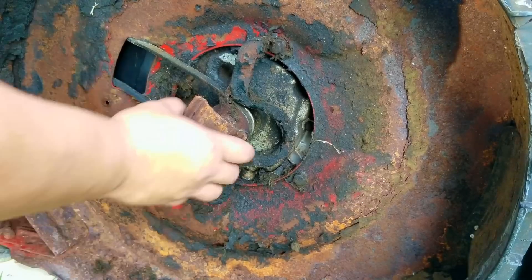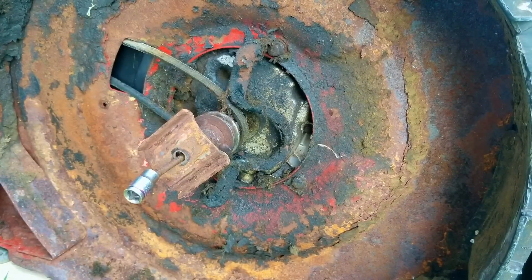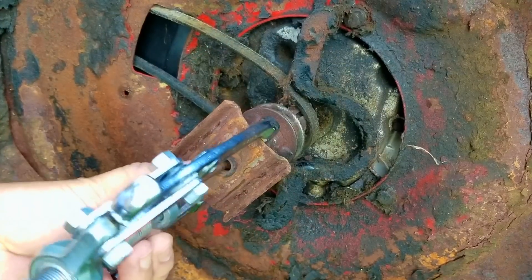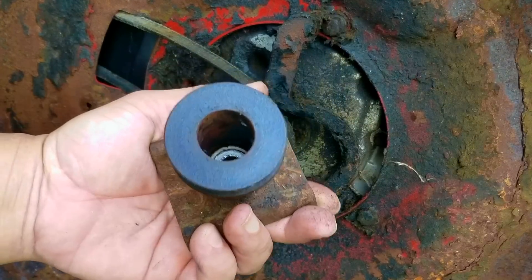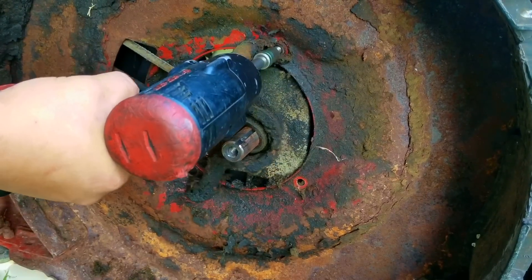Unfortunately after removing the puller and the bolt, ours is still not wanting to budge off the crank. This time I'm going to use a bolt or screw that's several inches long instead of the one which is only a few inches — this should give us enough pull length to get the adapter completely off the shaft. As you can see, just like the rest of the mower the adapter has rust inside it too, so we'll need to clean that up before installing it back onto the shaft. Once the adapter is off I'll remove the rest of the engine bolts and separate it from the mowing deck.